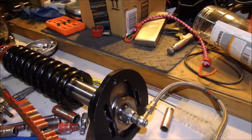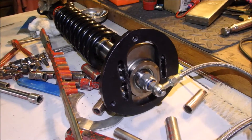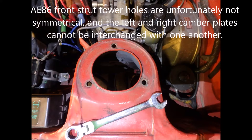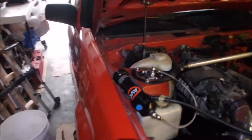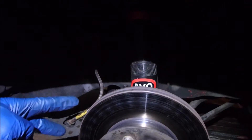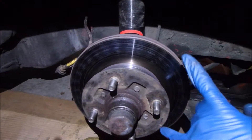The issue here is that the camber plates came installed backwards. The right was on the left side, the left was on the right side. When it's installed, the brakes have to sit — they normally sit in the front where the calipers are sitting up here.